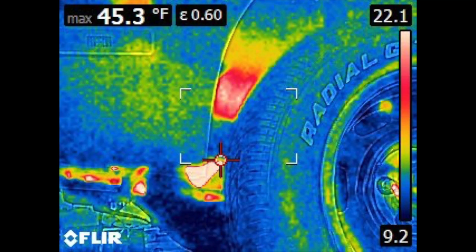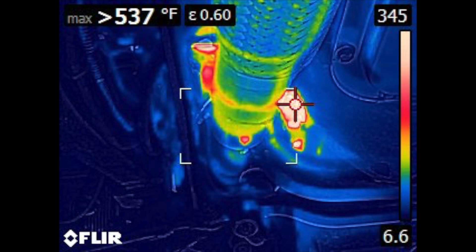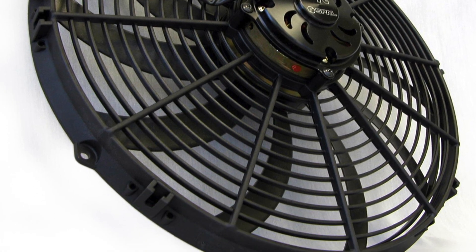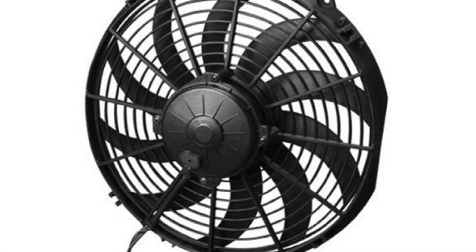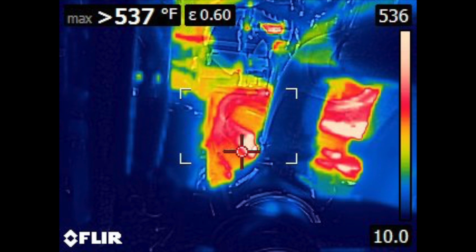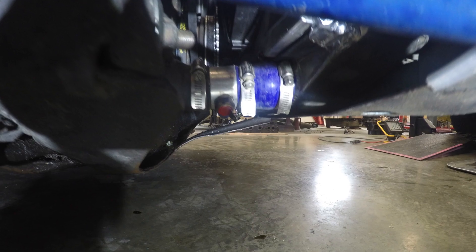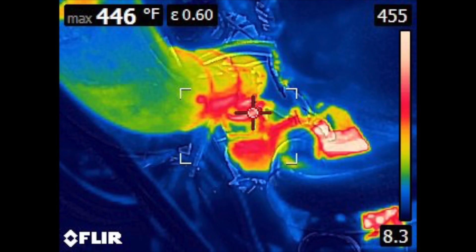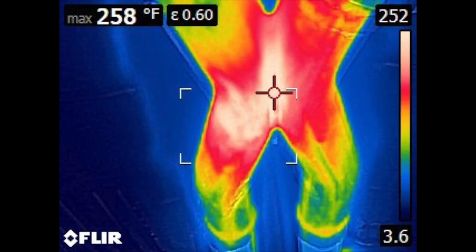With the limited space, replacing the fans on the road was a challenge - you can't just pick up high-grade cooling fans anywhere. Both replacements came from O'Reilly's; I think they're Hayden fans. They were better than what came with the radiator kit but still not quite adequate. Since the trip, we've upgraded both cooling fans to Spal fans, which have significantly higher flow - almost double the O'Reilly ones. They were more difficult to install because of the large motor on the back, and both fans had to be moved slightly to clear belts and pulleys.